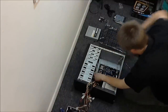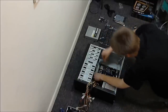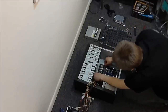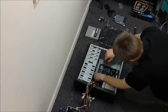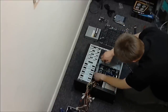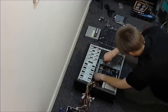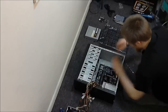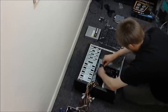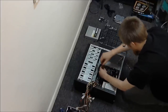Always good to double-check those fins because one little piece of metal in the wrong place and the first time you boot it up you can have a nice little spark show or burn up a piece of equipment. It's not like this is the most expensive motherboard out there, but why replace it if you don't have to — it's a brand new piece.